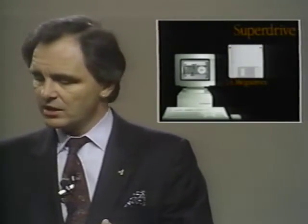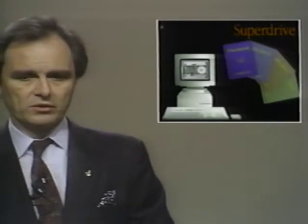The floppy drive is the new SuperDrive from Apple Computer, 1.4 megabytes of capacity, compatible with the 400K and 800K formats that we used previously on the earlier Macintosh. It also provides data file compatibility with other environments, such as Apple's Apple II ProDOS environment, but also MS-DOS and OS/2 environments, thus making our customers' lives even easier in a multi-vendor environment so they can move data around without difficulty. So this is the Macintosh IIcx.